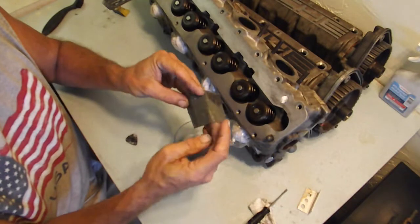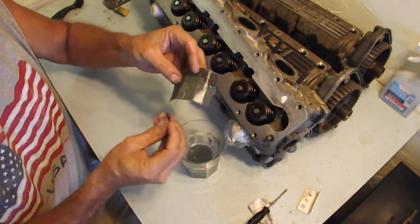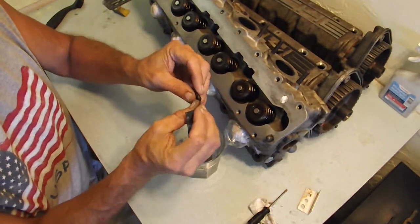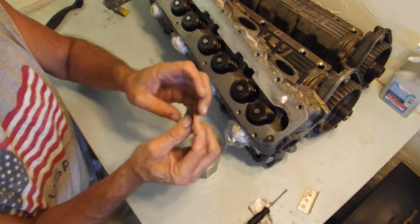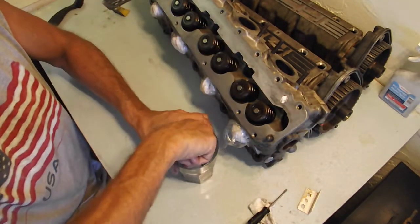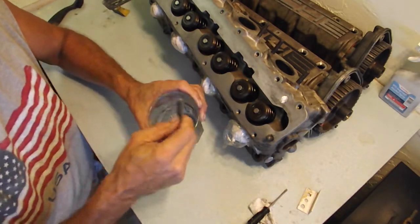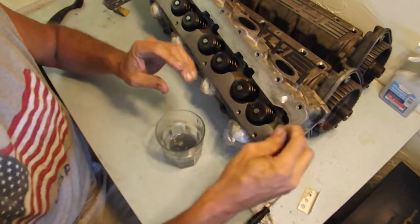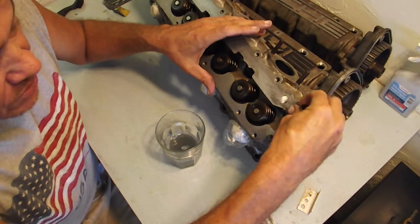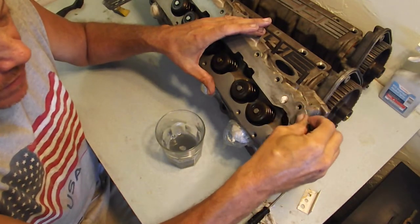That way, when you sand on it several times, like I've done with these other areas, got my guitar pick here, put this together. So if you see that area there, that's still pretty clean. And there's soap in the water. Now I've got too much soap in the water. And the way you know you've got too much soap in the water is it feels too smooth too quickly. It's hard to explain, but it's kind of a feel thing.